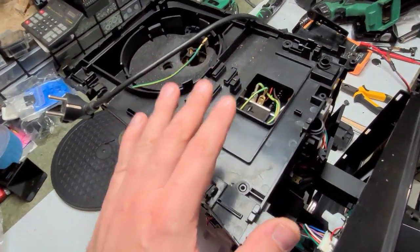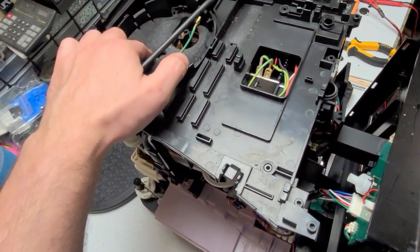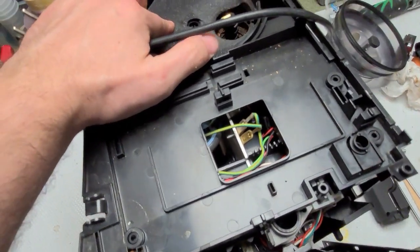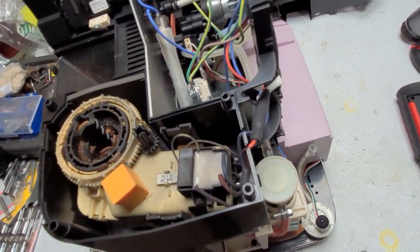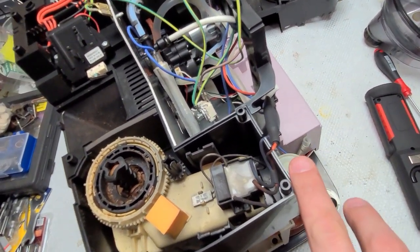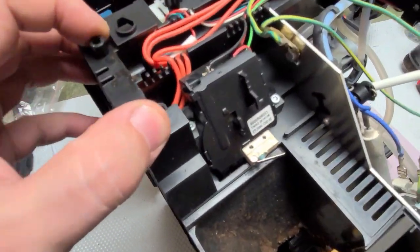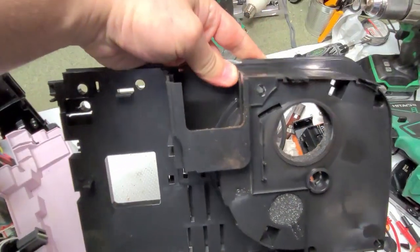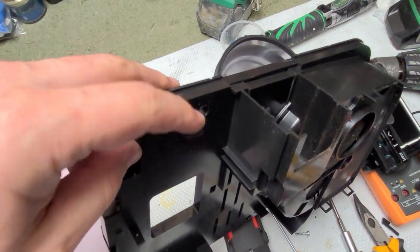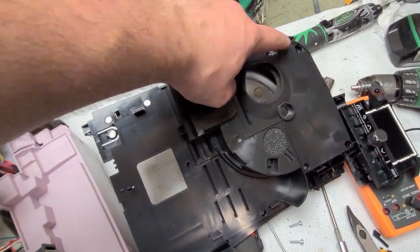Additionally, once it's disassembled to this stage, I will remove the upper cover to get access to the grinding motor and check its carbon brushes — that's the word I was missing. You have to unhook three or four plastic pieces that hold it in place. Be very careful — they are quite easy to break. Slowly lift them and then I can open up the housing.